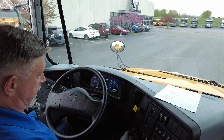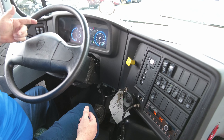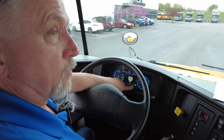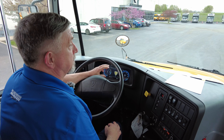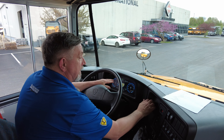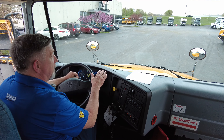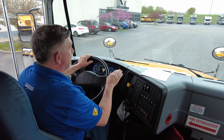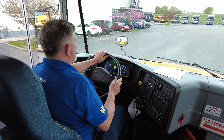To start this bus, you turn the key on, foot on the brake, hit the ignition just like you do in an internal combustion — that starts it. You can hear the air compressor running right now and we are in third stage regen. The way it's been told to me: put it in three and let it be. It's the most aggressive braking system, but it will require some driver training to feather the throttle. I'll let off the throttle and you'll feel it jerk us forward. The trick is feathering that throttle on and off — you never really have to touch the brake.